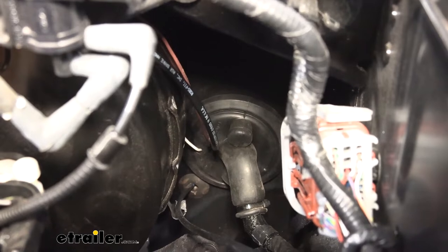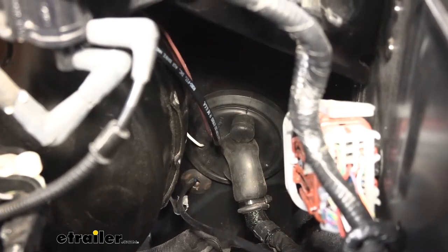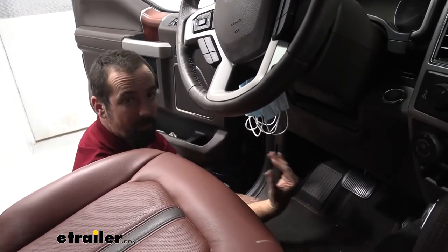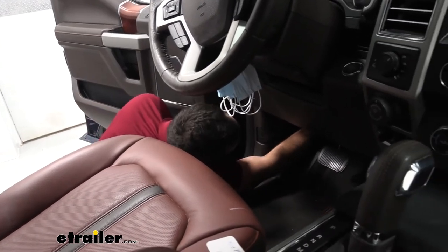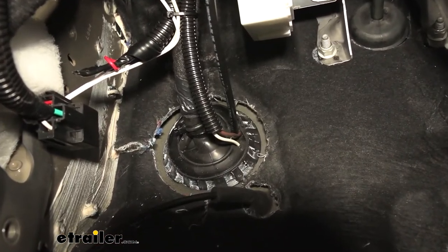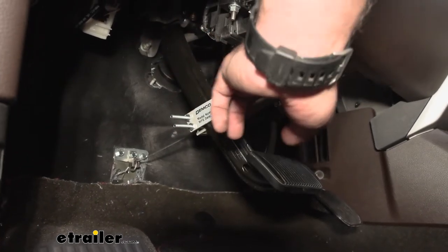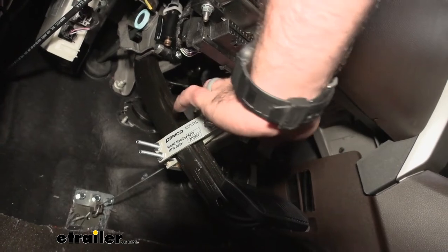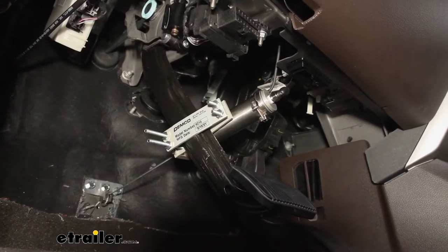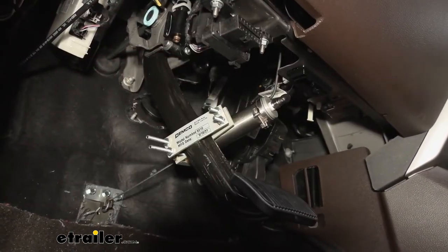When you lay out the planning of your flat-tow system, attach those wires through and pull them so you don't have to feed them in one at a time. On the interior of the vehicle, we're going to be connecting the rest of our wires and components that we fed through the grommet. The grommet should be pretty easy to find — it's tucked up a little bit here, a big rubber hole that's filled up, and that's what we're going through. You can see the cylinder mounted up, and the airline is going to attach to the fitting up here to make that connection. There's also a reed switch here, and that reed switch is going to feed back up to a module I have mounted. I just tucked it up here and used a self-tapping screw to keep it in place.